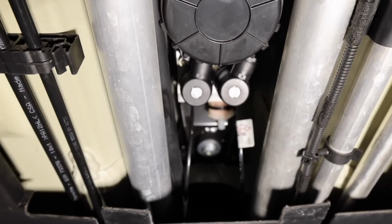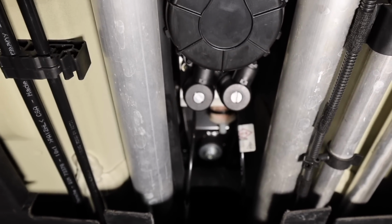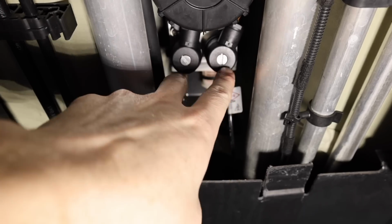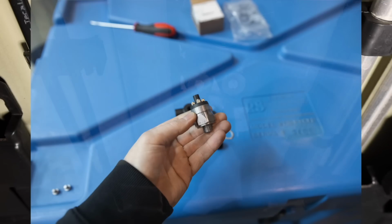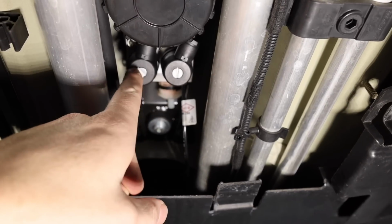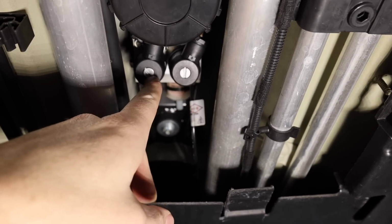Yeah, that will work. So the other thing I did is another maintenance issue. The axle lift stopped working, and it's generally the pressure switch. There's 2 pressure switches here. I'll put it in the description which one you need. It's about $400.